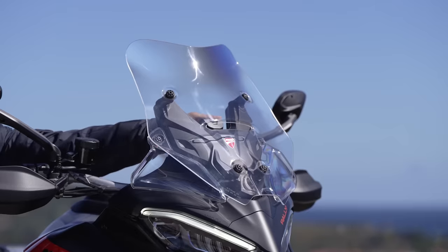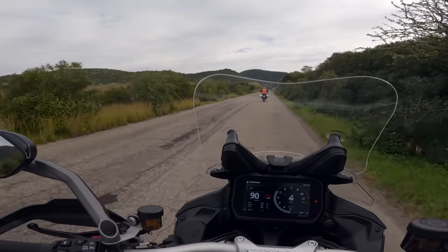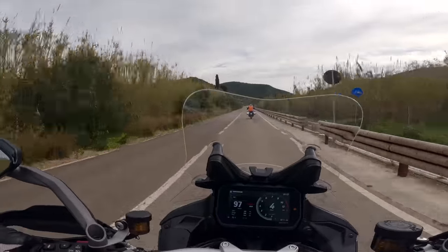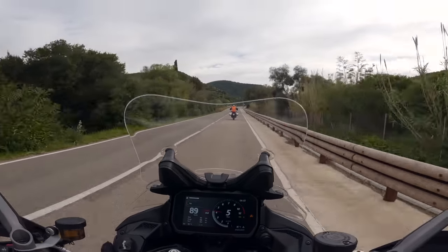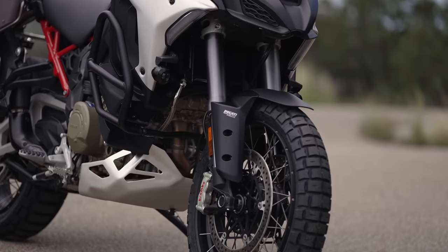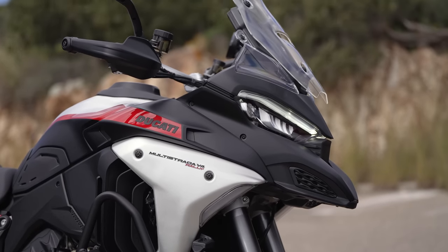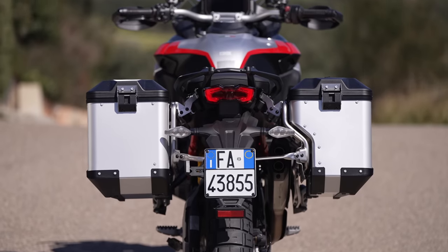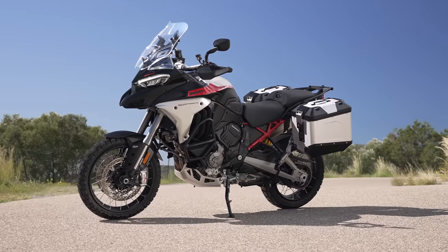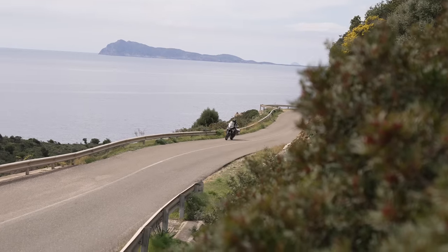A couple of neat touches: there's an adjustable screen that's taller and wider than the standard Multi V4, with a new deflector as well. On the side there's a little phone box where you can plug in your phone and get all your interactive features. It has a foam lining to stop your phone getting rattled to pieces, and it's also air-cooled to stop your phone overheating while it's charging all day. On top of that, they've given it slightly longer travel suspension — 20mm front, 30mm rear — and they've refined the air vents, moved the panniers backwards, and moved the top box back to give more pillion space. When Ducati went through their list of changes, it was as if they'd launched a whole new model — loads of small tweaks in response to feedback from their test team and from riders who bought the original V4.